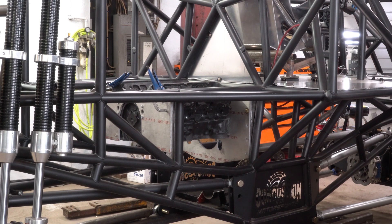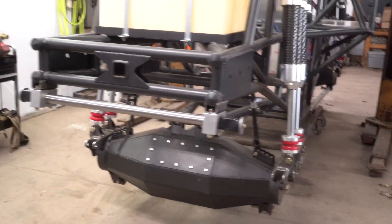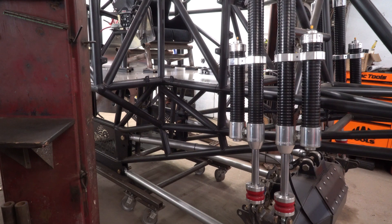Right there you can see the sway bar. I got sway bars for front and back through Patrick Enterprises, and the arms are out being powder coated so those should be back soon. I got the rear bar mounted in, but I haven't mounted the front bar yet. The sway bar on the back mounts at the back of the frame, but I couldn't do that in the front because the shocks are so big — they came from Race Source and they have accumulators — and the front of the frame is a bit shorter, so the front sway bar is going to mount behind the axle instead.